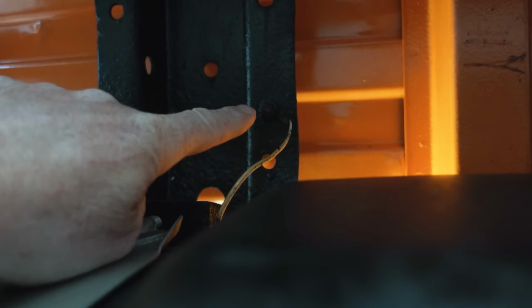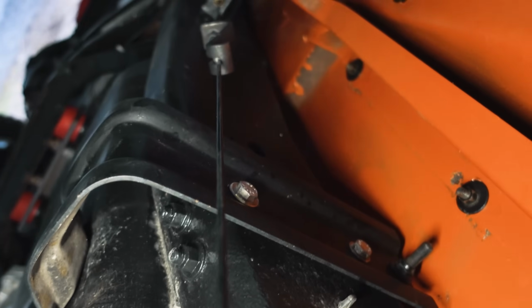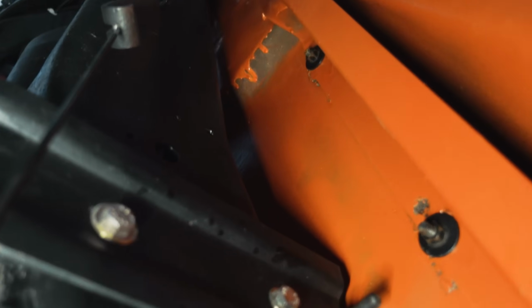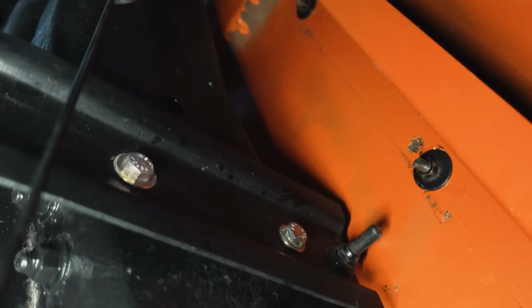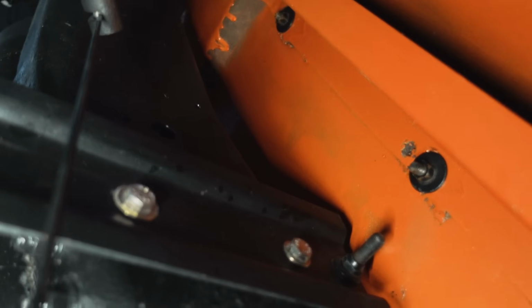I don't need to clean that ground. Okay, so I said, new straps. I'm gonna drop the tank. The problem is, when this was done, he must have done this when the bed was off of it, because I cannot access the nuts on the backside of those bolts. No way I can get to them, and they just spin.